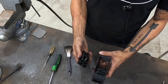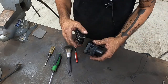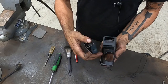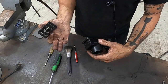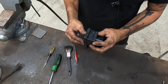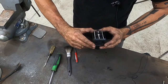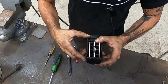I'll show you a trick also on these. As far as the Kenworth — I'm not sure if Peterbilt or other brands are this way or not — but when you're putting this thing in, the two tabs on either side of that vent are to the outside, and you're going to want to push against those to put your vent piece back in the duct. As I push, those two tabs just popped out.